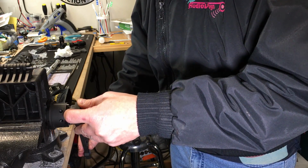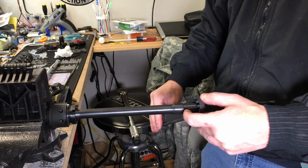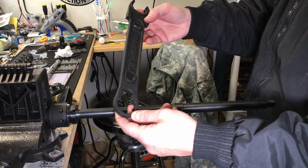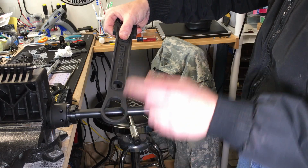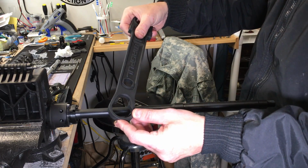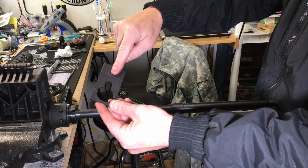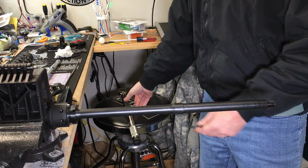And they both line up. Now, one thing I should mention though, in this particular situation, my torque wrench would be attached right here. So we have this extra length that's added onto the torque wrench. So you have to take that into consideration when you set your torque settings. In this particular situation, the torque wrench goes right here, so there's not much of an added length.